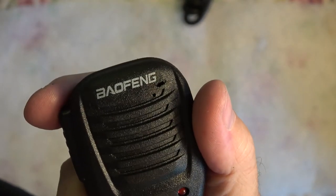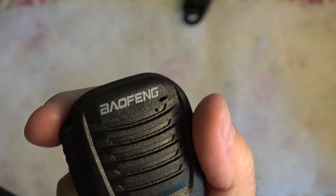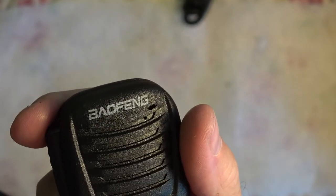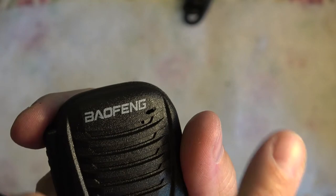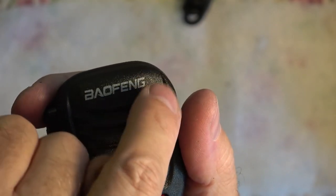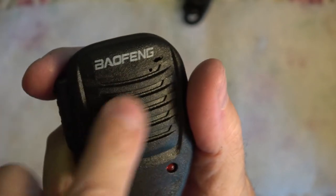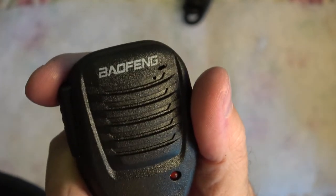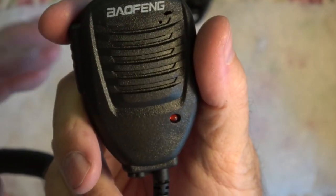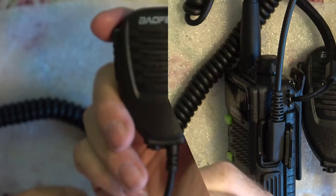See that hole that we've created? That big hole just below the G on Baofeng — that is going to improve significantly your sound. Plus, of course, we have sealed around the microphone now, so that only the audio goes from the hole to the microphone condenser element and doesn't bounce around inside the body anymore. And there you have it — that's your modification for your Baofeng microphone.